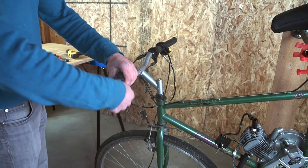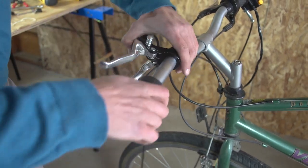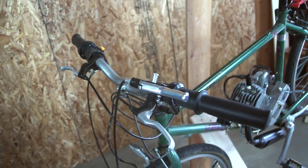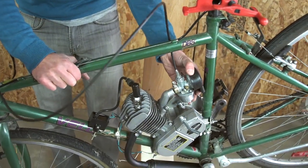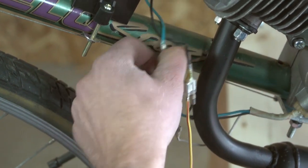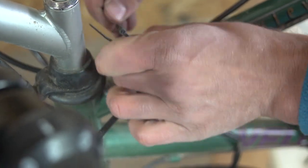Remove the left bike grip and slide the included clutch lever in place. Your bike kit also comes with a replacement matching grip for the left side, which should just slide into place. Install the carb, which should be attached to the cable from the twist throttle, and tighten it in place using this screw. Plug the wires from the kill switch coming from the twist throttle into the wires from the engine coil igniter. Use zip ties to hold all these wires and cables in place and out of the way.